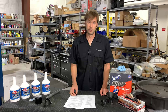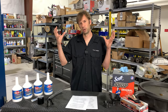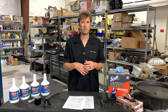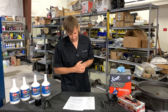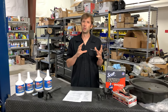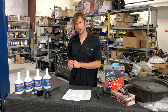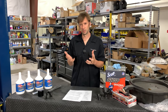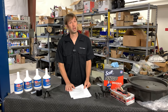Does the car have to be warm to drain oil efficiently? Yes — hot oil is more fluid, flows more easily, and carries more contaminants with it, giving you a more complete oil change. It's not the end of the world if the oil is cold, but you should aim for warm oil. On Rotella diesel engine oil: it's great for engines due to high zinc content, but that same zinc content is bad for O2 sensors. Since all the Miata generations we deal with have O2 sensors, we don't recommend Rotella — it introduces additional, more expensive maintenance issues.